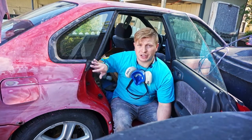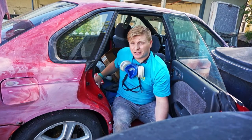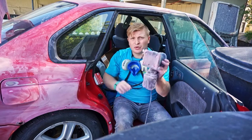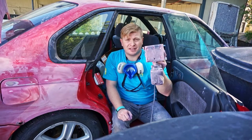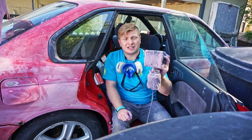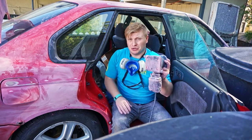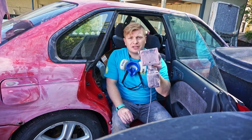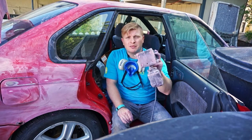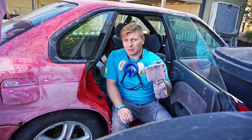Here are some tips if you're going to be sanding down your own car. The other day I sanded down the whole car with a palm sander. This isn't an orbital sander — it's just a normal palm sander which makes it a lot cheaper, and you can do the orbital part on your own. It only goes side to side, but if you spin it yourself that kind of does the orbital part.